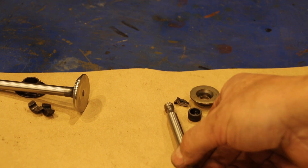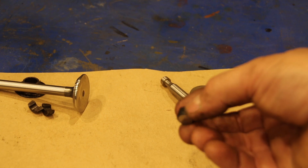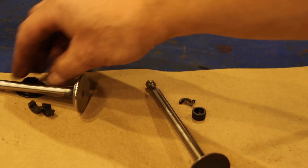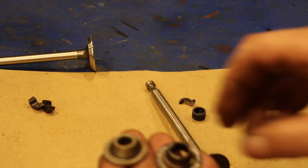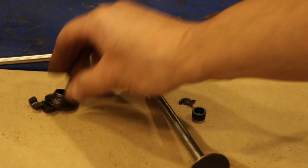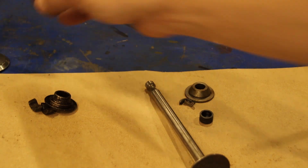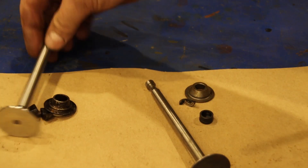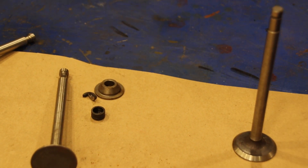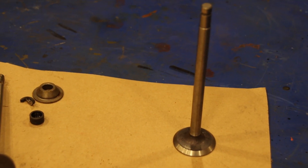The capped valves are kind of available, but the caps can sometimes be a bear to find. These keepers have a different shape than the standard ones, and that's necessary with the cap and the retainer. That's what started happening in 1952. I do a lot of M38 engines — amazing how many I do compared to how many were made.